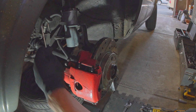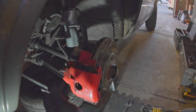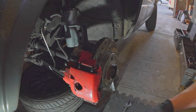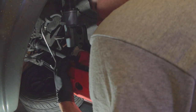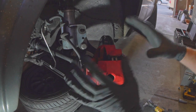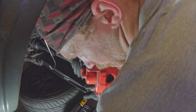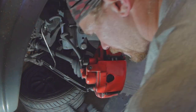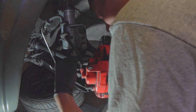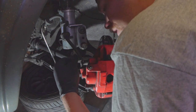It's a good idea to have some kind of brake hanger, because you don't just want to hang it on its brake line — that's no good. You could take the two caliper slide bolts off, which would be like servicing your brake pads, but what's quicker and easier is you don't need to take those two off. You want to take the brake mount bolts off. I feel like everything on the Rabbit is a 17, a 19, or a 15, and a few other random weird sizes.